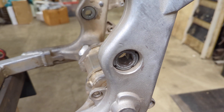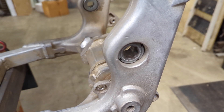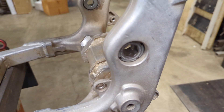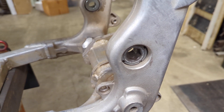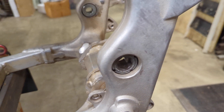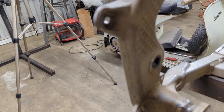There's an adjustable bushing in the left-hand side of the frame. This is so that you can adjust it for the different widths in the swing arms, for machining tolerance, without overstressing the frame. We'll adjust that later on, but it came with that bushing in it, so that's good.